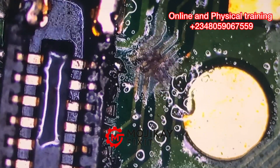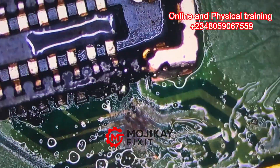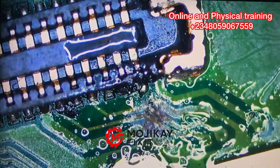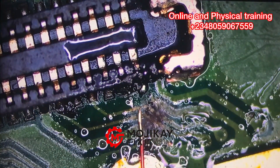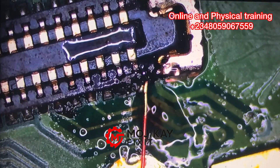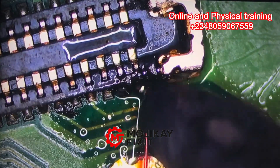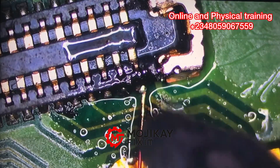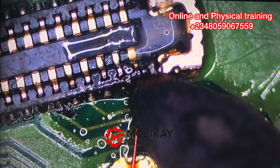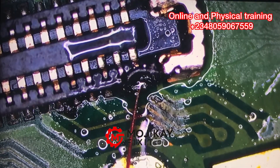I've tried to read with my multimeter as well, and I saw there was an open circuit. So we're not just repairing the pin — we're also making a jumper from that diode to this first pin. Remember, this is the first pin that triggers the light on the LCD screen, so we are making a jumper.